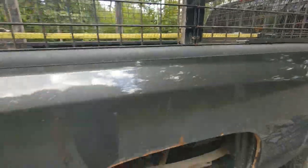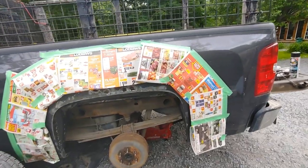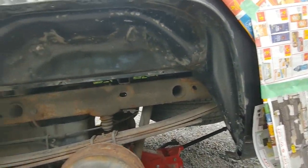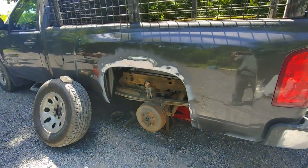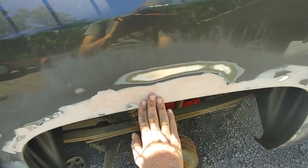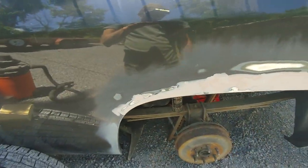The driver's side is worse — I guess because of more splash from cars and road salt on the center line. I'm not trying to make it look beautiful, just want to stop the rust. I really like this truck and want to make it last — I'm only at about 125,000 kilometers. The next day I've done quite a bit of sanding — about four layers of Bondo, put on and sanded down with 100 then 220 grit. I feel good about going ahead with primer now.